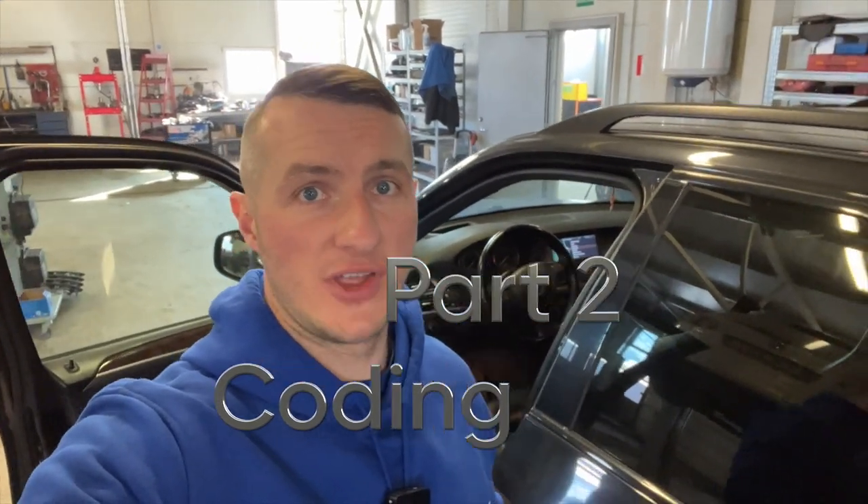Step one is done — we have physically disconnected the ECU. Let's go to step two: coding. We will use NCS Expert for that operation because this is E-Series. I will also use VCX SE to connect to the car. It's also possible to code with a DCAN cable or ICOM — it doesn't matter since we're doing only coding and diagnostics. For today's coding I'll use this Wi-Fi-based tool. It's convenient to work with. It's a Chinese tool that imitates basically the same as ICOM. The only difference is you cannot reprogram the head units of the E-Series, but all other jobs like coding, programming, and diagnostics can be done with it easily.